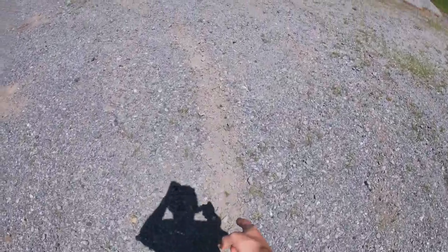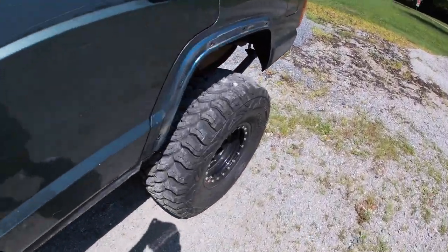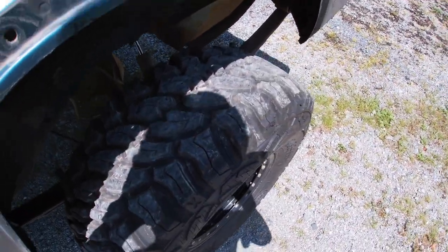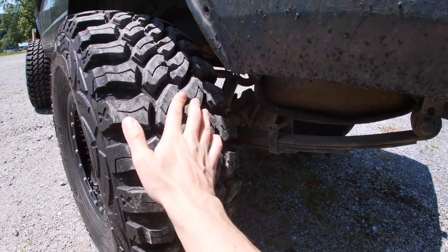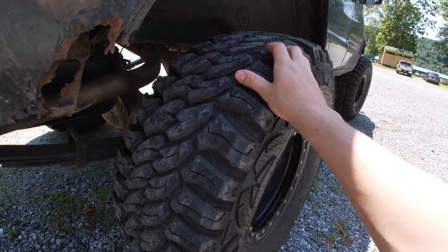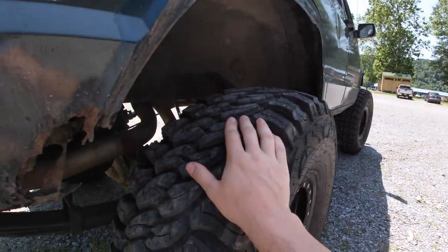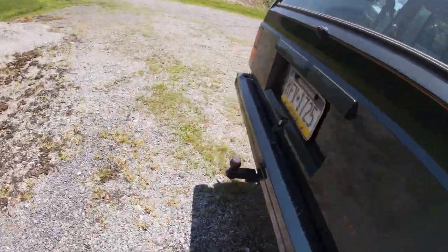As you can tell, I started about here — this was the inner tire and you can see it was skipping rocks. The outer tire was doing the same kind of thing but not as bad. You can tell up until the point where I stopped, the Jeep was skipping the tire. If you come look at the tire, obviously there are rocks stuck in here, but you can tell just by looking that it's got skip marks — there's definitely some wear on these tires from having the welded rear. This tire isn't as bad because this was the outer tire; the inner tire was the one really skipping.